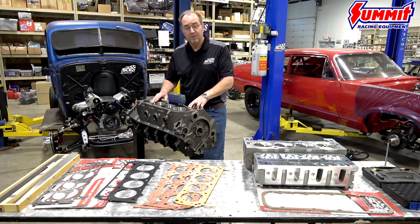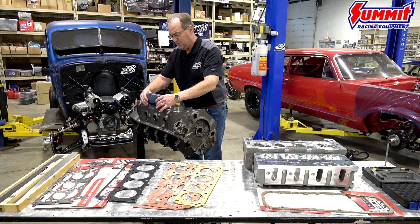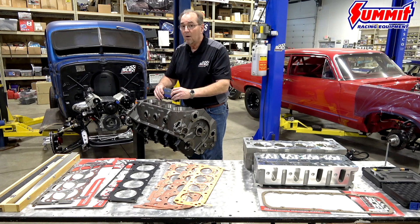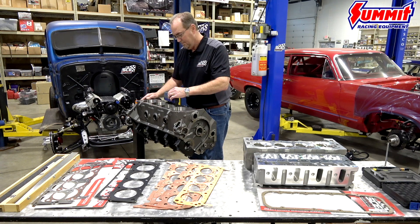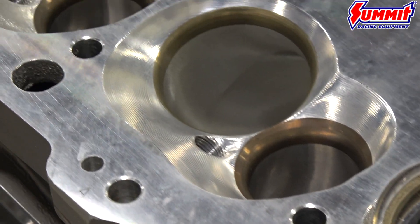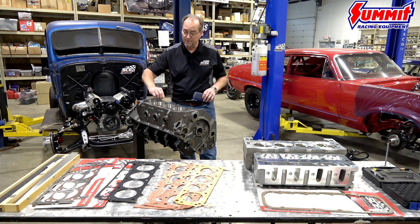In this position we're measuring a 57RA. We can go to a different position on the block — in that position we show a 59RA roughness average. In this position we show a 31RA, and if you take a close look you can see there's a difference in the surface finish. I can feel it with my fingernail — there's a different machine pass here. This is a much smoother surface finish, and if you do the fingernail test you can tell there's quite a bit of difference.